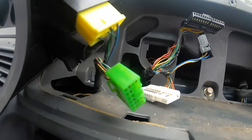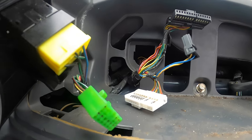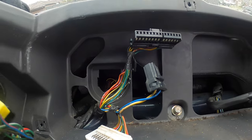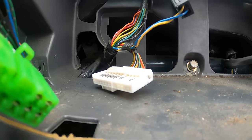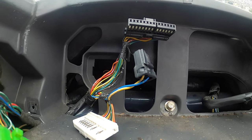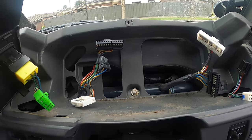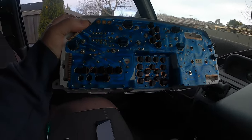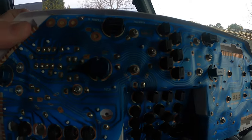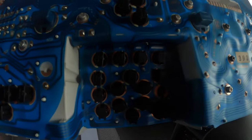Just be careful when wrenching on everything that you don't break anything in there. The green one goes to the hazards and the rear demister I think. Over on the left hand side of the cluster there's actually three plugs - the bottom white plug, a middle small two-pin one, and a black one that sits at the top of the cluster. So that's it all pulled out - now we've got the back of the actual cluster and you can see all the globes in there. It's just a matter of twisting these little sockets out and replacing the T-type globes in them.